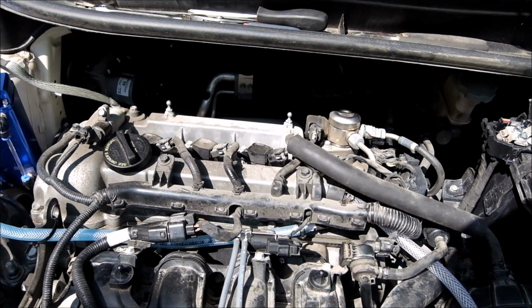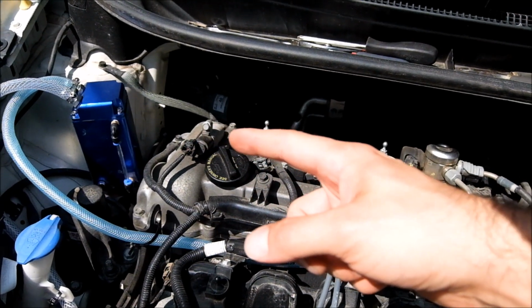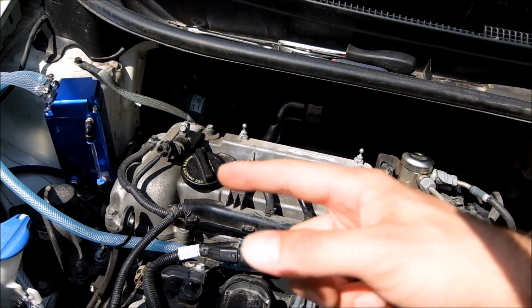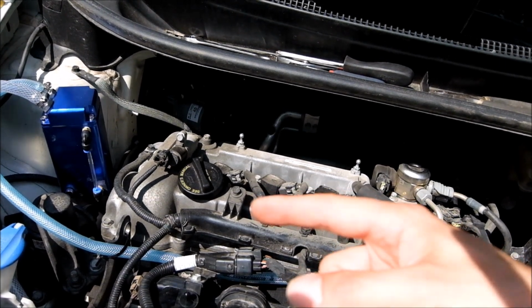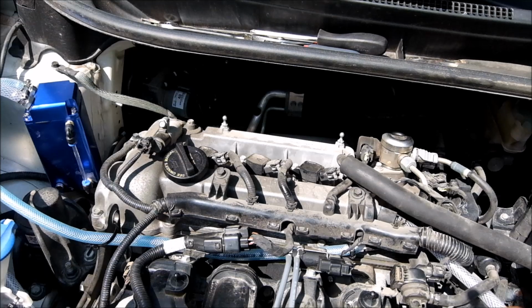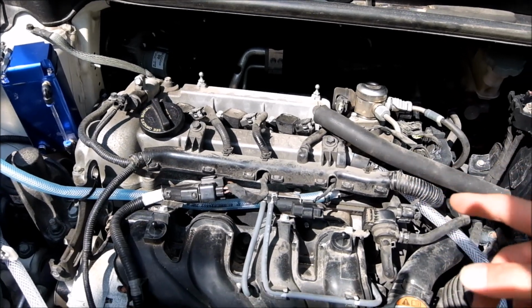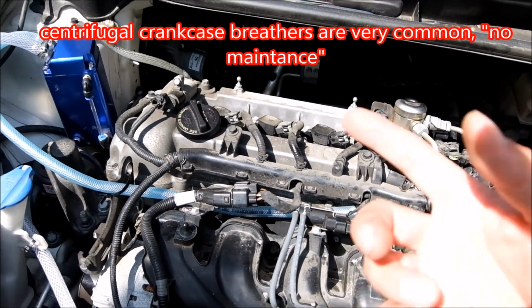Now, in your big rigs, like I work on, they actually have a filter, a CCV filter, closed crankcase ventilation filter. Sometimes I want to say it is a fiberglass mesh. Those have to be replaced quite often. Some of them have gotten away from that altogether. Anyway, the industry has used them. Some do still use them. There's a spinning type filter.